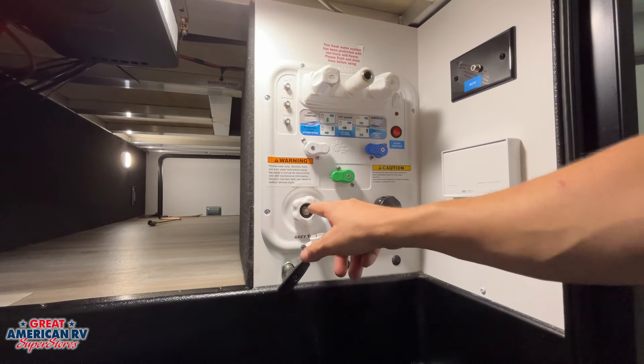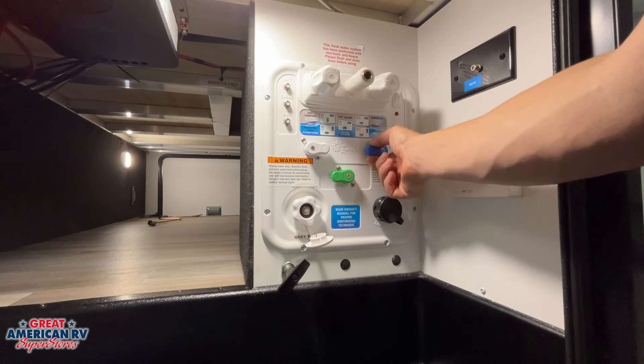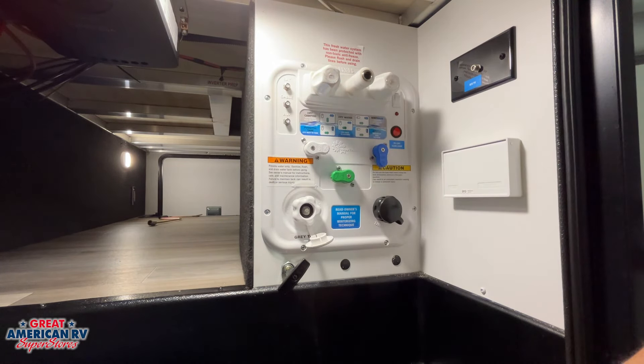The winterization option pulls from here into our unit — that hose would need to go into a bottle of RV antifreeze to winterize. There are more steps to this process, which you can find in your owner's manual or in our HAPS Helpful Hacks video. Our last option is siphon sanitize to tank — that's to sanitize the onboard water storage tank. You do a mixture of bleach and water into that tank to sanitize and clean it out.